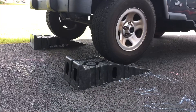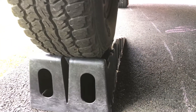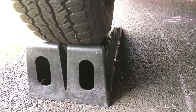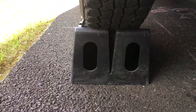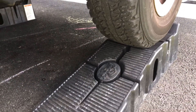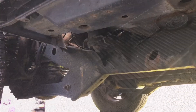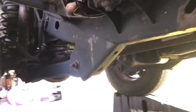It's best if you can get the Jeep's front end up in the air. I'm using some Rhino Ramps here. If you want to see a product review I did for them, you can check it out via the link above — I also have it down in the description. But if you don't have these, then it's recommended you use jack stands. You do not want to rely only on your vehicle jack. Sliding underneath here on the driver's side.